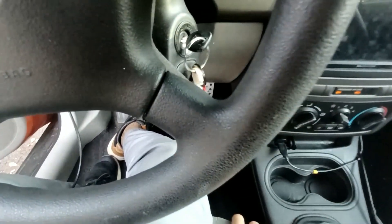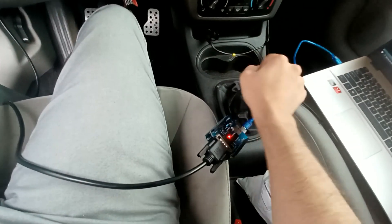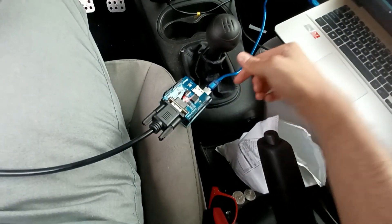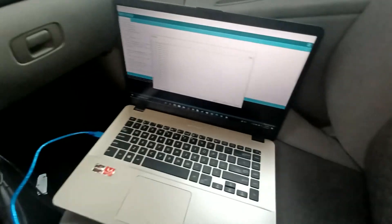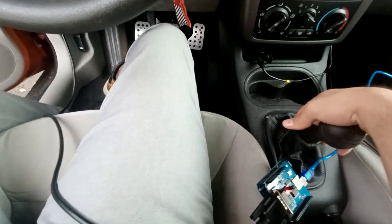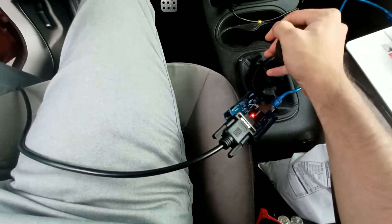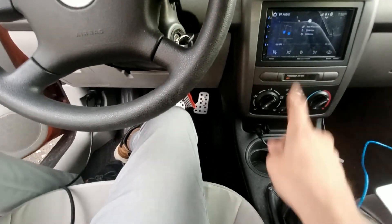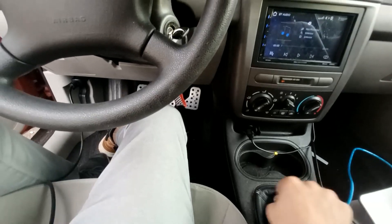You'll see 'testing CAN' and 'no SD card' — that's fine. Right now it's listening for signals. Insert the keys into the ignition and turn it on without cranking the engine, and you'll start getting CAN codes coming in. That's how you get up and running with the CAN bus shield. In the next video I'll add an SD card, log the codes, decode what they mean, look at PIDs, and maybe interface them with electronics around the car. Thanks for watching!